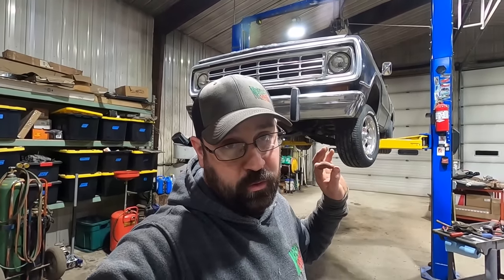And then I just gotta fix my little screw up for my 1/2 inch to 5/8 and 3/4 inch bolt. So we'll either make a step shim with a longer bolt or we'll just make a shim and tack weld it in place. Anyway, not a big deal. Worst case scenario, we gotta go find another rig, knock the rivets off, steal that bracket off of them. So it'll be fine.